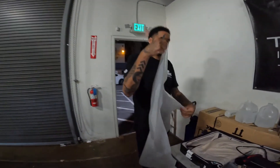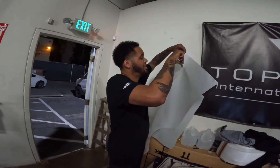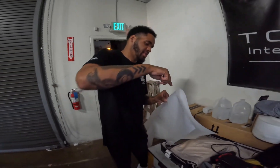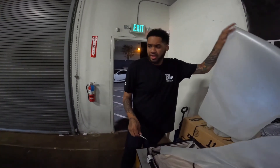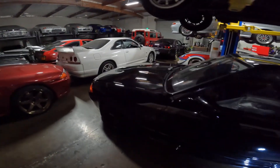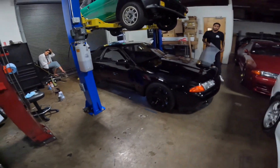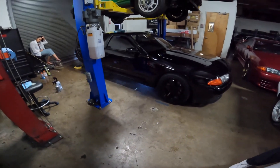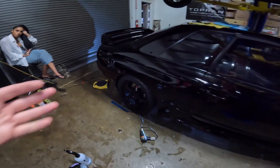Add this to the long list of late nights working on this thing. Just finished some paint protection — got the high-impact areas, so it should be ready for track. The high-impact areas are typically your front end: hood, front bumper, headlights, sometimes mirrors, rockers, and the quarter panels. Really depending on whether your vehicle is rear-wheel drive and what kind of tires you have. This car is all-wheel drive with sticky tires, so it's going to fling stuff everywhere. I know people hate following me on the street because the tires just throw things all over the place. Even with all the extra guards and spats, it's still going to fly everywhere.